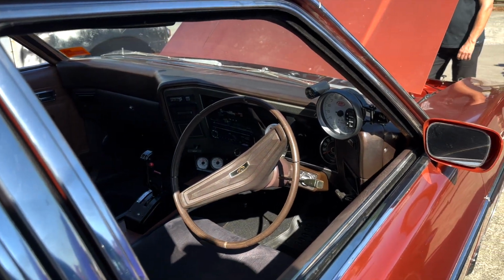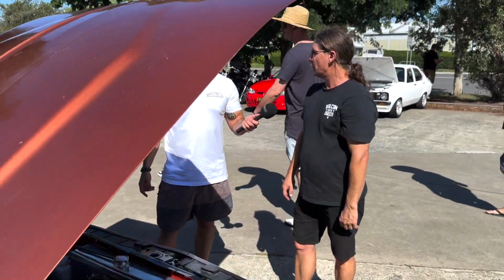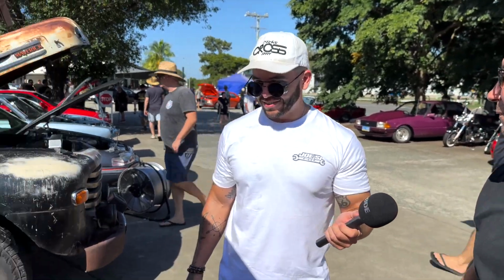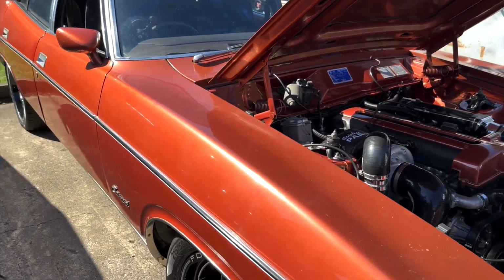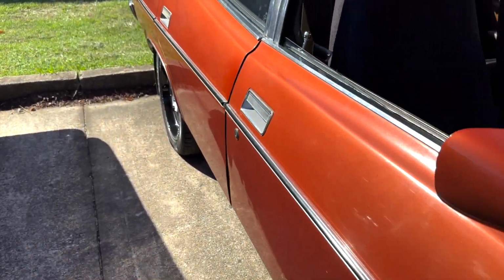And the turbo, box and diff, sorry? Yeah, Turbo 400, reverse pattern, trans brake, full manualized. Diffs are 9-inch, 3.2s. This thing is set up. Wow. I had a limited slip, and it just used to throw me in the other lane. So I put a full spool in it, and it just keeps nice and straight.